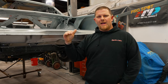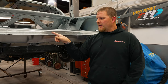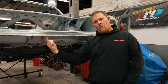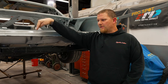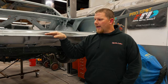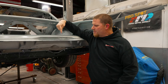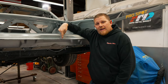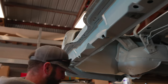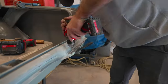If you want to be efficient — whether you're a guy in your garage or working in a shop — think about what doesn't matter and what does. If we know the upper panel is going to remain in place, would you rather MIG weld upside down, or pre-plan and drill the top side of the pan so you can just fill it right up? It's going to land into the bottom of the pan and it's easy to take a 36 or 80 grit roll lock and clean up that plug weld. Sometimes you don't have access — it kicks inward and you can't even get a drill bit there. So if you have to take a roll lock or belt sander and wear away the bottom pan in that area, just work from one end to the other in a slow, methodical way — not rushing, thinking about everything as you go.